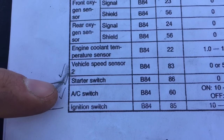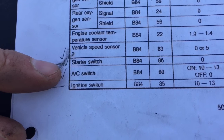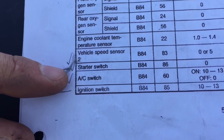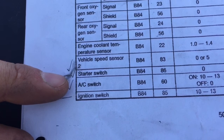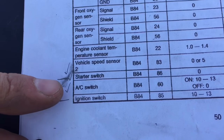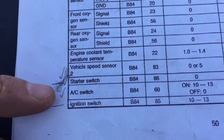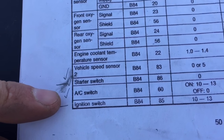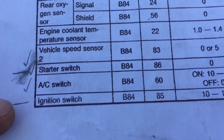The AC switch was covered in the last video. Basically it will idle the engine up if it senses that the switch is turned on. That's great if you have accessories that take a lot of draw, like big lights or powering a fridge — it'll add two or three hundred RPM to the idle speed, which will compensate for the big draw on the alternator.